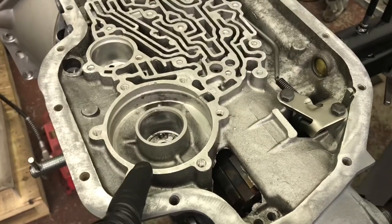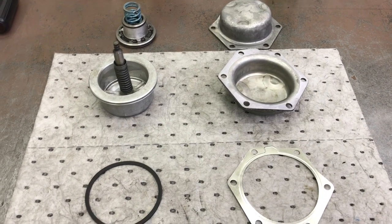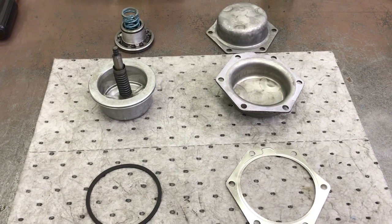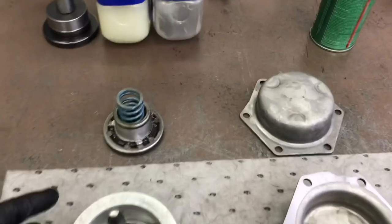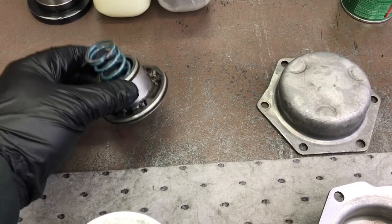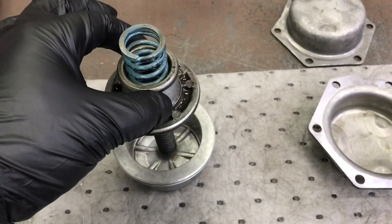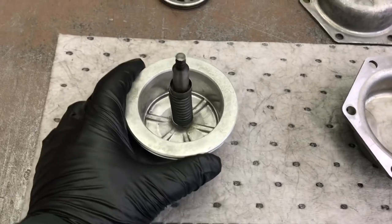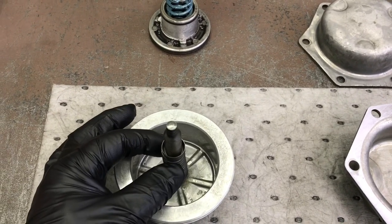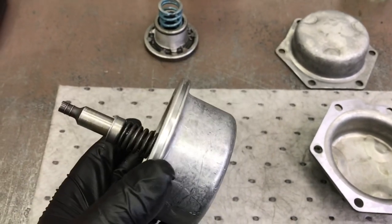Now let's move on to the rear servo. Consulting the ATD Billet TH400 Transmatic Valve Body instructions — they take a different approach than other kits I've installed. Normal procedure is either to remove the rings from the 1-2 accumulator and use that as just a spring holder with a stock spring inside the apply piston, or others have you do away with it altogether and give you a giant spring. ATD tells you to junk all that stuff and install it as-is, with a new O-ring of course.